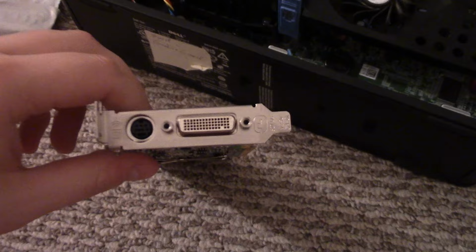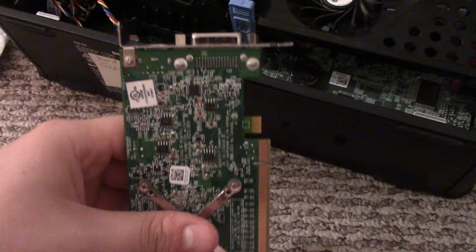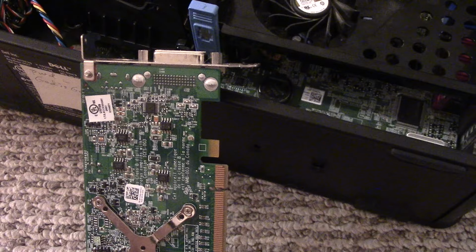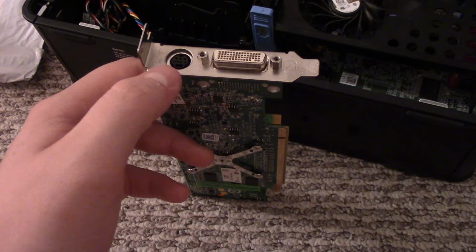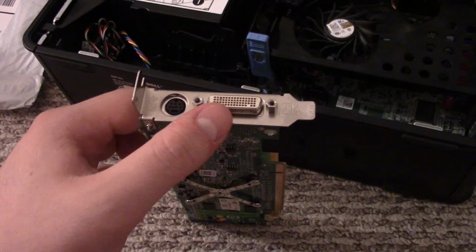There are actually a couple of reasons why DMS59 came along. When I first learned about it, I didn't really understand it, but as I kind of understood it a bit more, it made more sense. Back in the analog days, it's not like HDMI and DisplayPort. In terms of manufacturing, it would have been simpler to have one connector on there and then just have the signal split out into two different ones rather than have two DVI or two VGA ports on one GPU. Also, for systems like this, it's a perfect use case. You see how this is only a half-height PCI Express bracket? Well, you can't fit two DVI connectors on here or two VGA connectors. The VGA connector, no, I think it's still too small. Anyway, you can't fit two display connectors on here. So it makes sense to have one that, when you use an adapter, can actually break out into two.